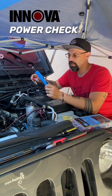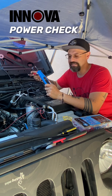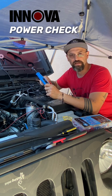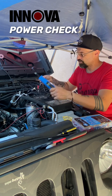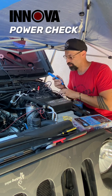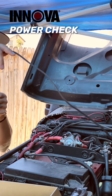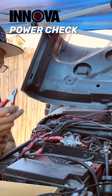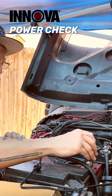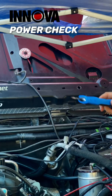It's a very affordable way to test what wire is what. I'm going to hook this up and show you how easy that is, then test it on a light so you can see where it comes in handy — especially if you have a rat's nest of wires you're trying to figure out and reconnect to something like an S-POD or Switch Pros. First things first, you're going to connect the positive and negative leads to your battery directly. There we go — now we've got power to the Power Check unit.